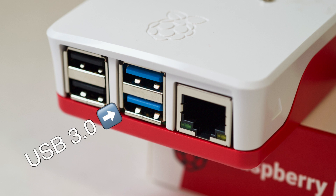So in the end, my advice is to always use UASP with the USB 3.0 devices on the Pi 4 — otherwise you're missing out on a lot of performance potential. Also remember to plug USB 3 devices into the blue USB 3.0 ports and not into the black 2.0 ports, otherwise you won't see any performance difference at all. Now what about USB flash drives or thumb drives — do they support UASP? If you want to find out, please subscribe to my channel. I'm going to do another video soon discussing all the different storage options for a Raspberry Pi 4, covering USB flash drives, SSDs, microSD cards, and even some other possibilities if you replace the USB 3.0 controller. If you found this video helpful, please consider sponsoring me on GitHub or supporting me on Patreon. Until next time, I'm Jeff Geerling.